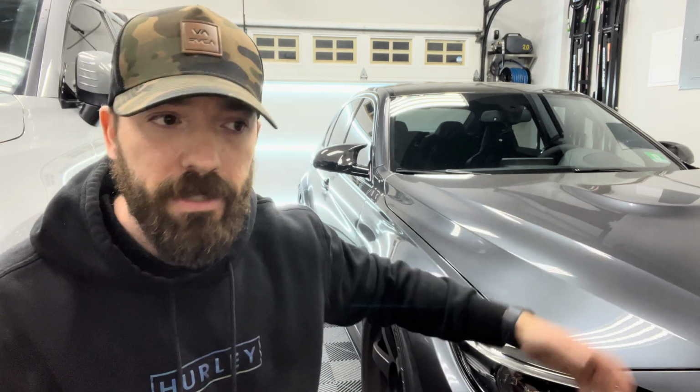Based on my experience with my car and the condition of it and the low miles and how it wasn't modified and everything like that, to see that these friction discs were actually cracked and split, I'm going to go and say that I highly recommend getting this done. I understand it's a very, very pricey thing to do, but spending a few grand to get this done as opposed to spending tens of thousands of dollars to get your entire S55 motor replaced, I'd rather invest in doing the crank hub now, enjoying a trouble-free ownership and never having to think about it again.